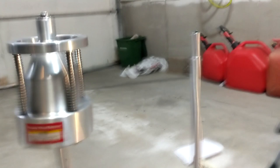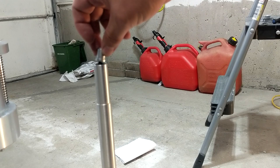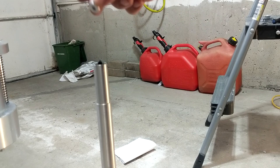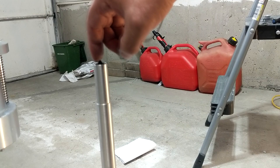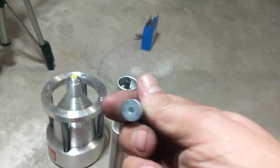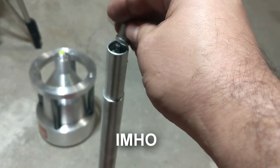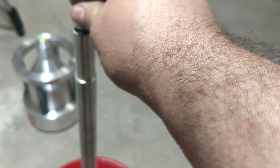I've got some grease on it, but you can feel it — it's hitting the shoulders and not even touching the pin. It's bouncing on the shoulder of the needle and not touching the center. So the way this was engineered, that tip was never meant to sit at the bottom of the hole — the shoulder would just rest on the hole itself to find its center balance. The grease does help, but if the tip ever gets chipped it would never sit right, and I think that's why it would stop moving too early without finding true balance.